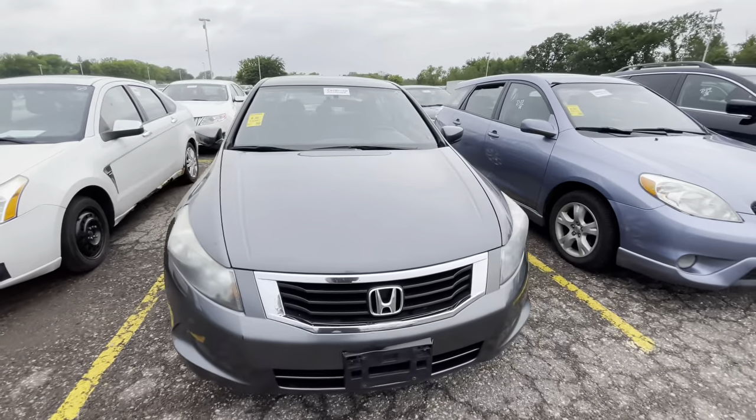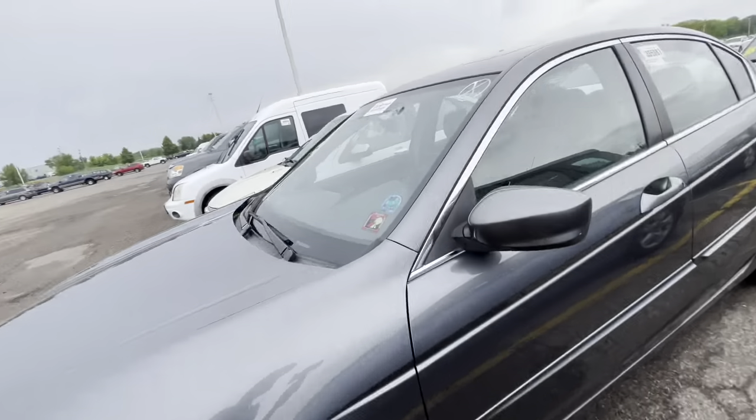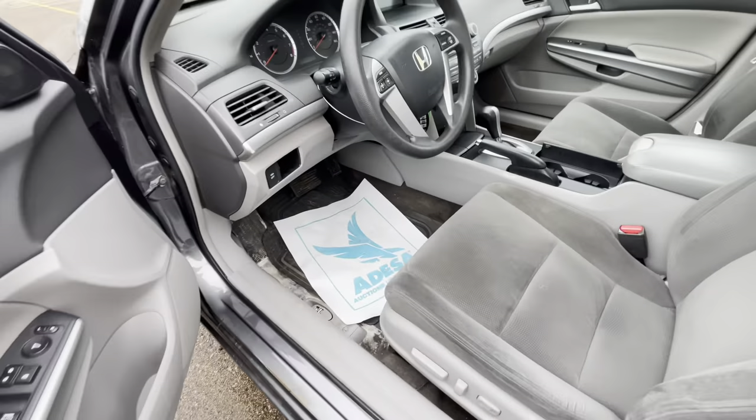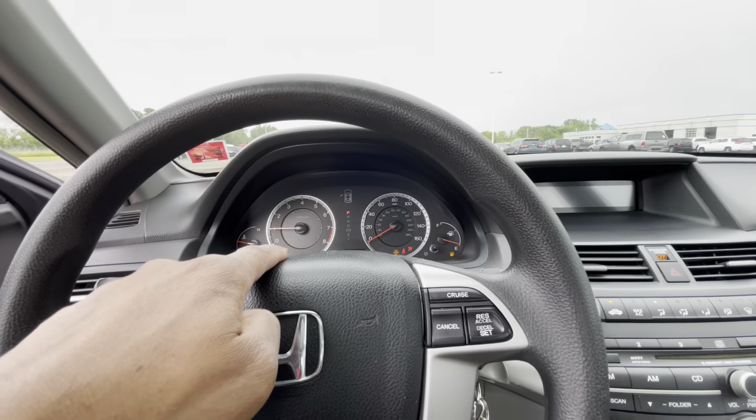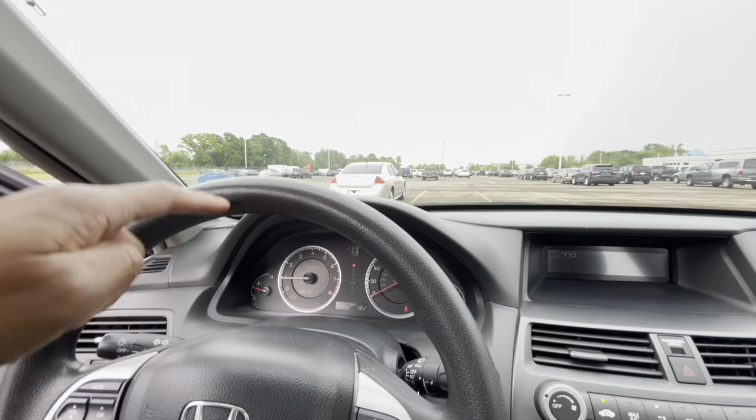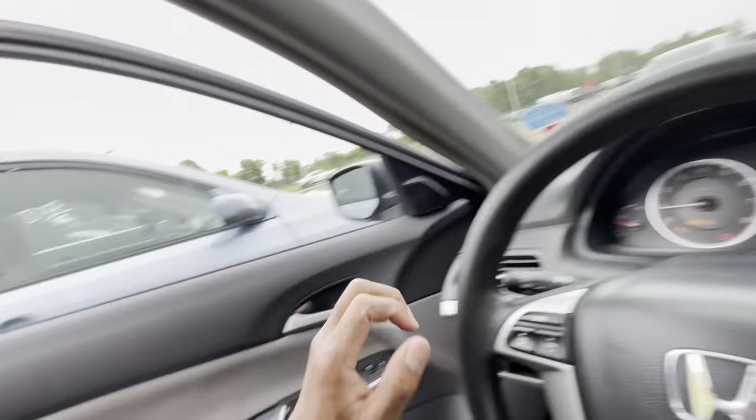But here we go — a 2009 Honda Accord with 175,000 miles. I'm gonna give it a shot. Salt on the ground. When you deal with these more expensive cars, I keep saying I'm not selling them 'as-is' — I want them clean and shiny so when somebody comes out they feel like they're getting a near-new car. We got a check engine light on and an alternator light. I'm gonna go ahead and cut this one off, but let me check the electronics first so it doesn't die on me. The alternator is getting ready to go out — battery light confirms it.